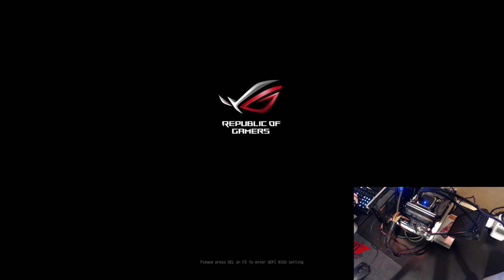but you can just keep pressing retry, as long as you're not getting something like 55 or 49 repeatedly, over and over. But if you're hanging on, say, 78, which I do believe is boot device initialization or something, it's really close to the system finally coming online. So if you're hanging on 78, 96, or B2, you can generally retry through that. And you might want to tweak your voltages a little bit because you're just below the edge of stability. So, yeah, RAM overclocking, very difficult.